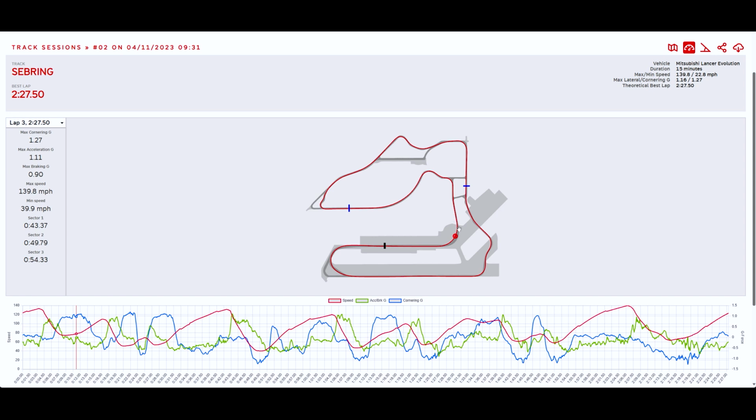So this is definitely taxing and testing that surge tank setup, taxing the fuel system for that fuel starvation issue. I thought that if I was going to have any fuel starvation, it was going to happen here or around this area. Happy to report that I ran the Evo down to even the low fuel warning light, and I had no fuel surge or no fuel starvation. So that's a huge plus.